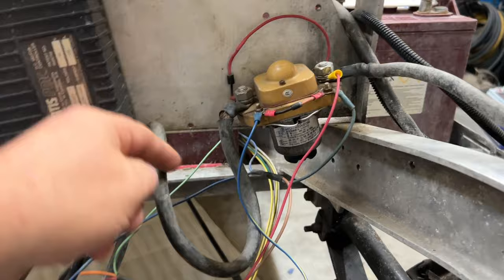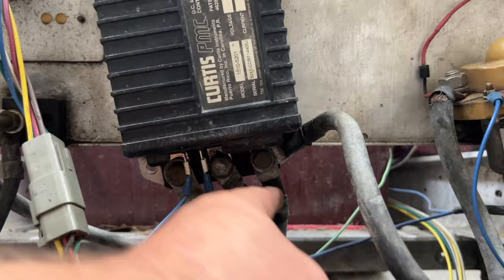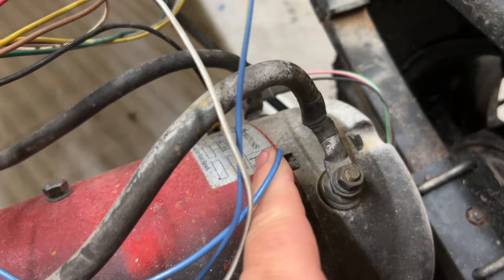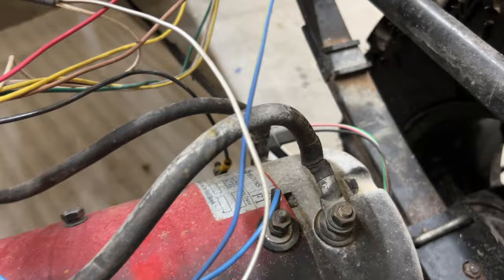This is the yellow wire or yellow cable going from the solenoid down into B positive of your controller. That's B positive. B positive leaves and should go down to A1, and it does. Look at that, they have put regular, smaller, anyways, I mean, that might work, but we might replace that anyways. So the heavy duty cabling on the solenoid into the controller there in that one run is correct.